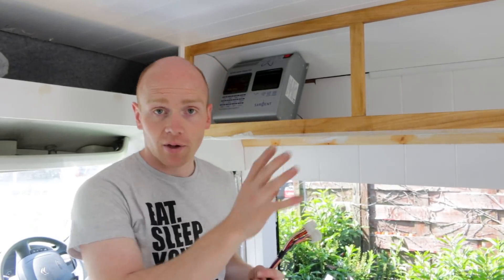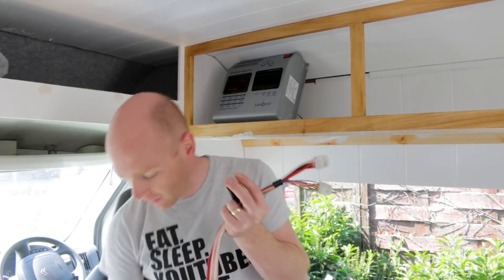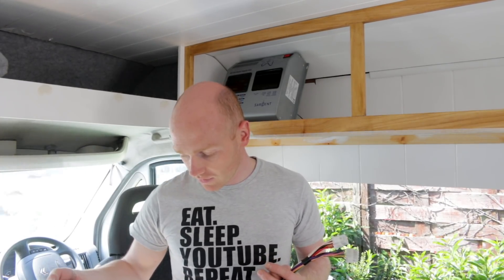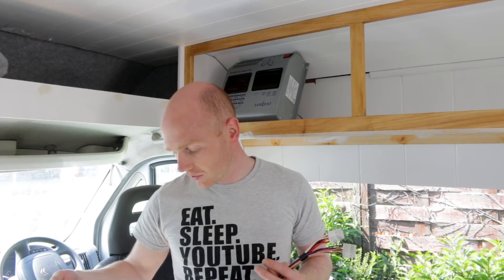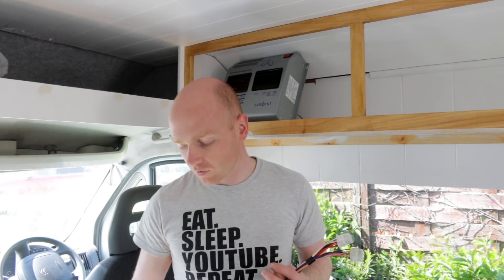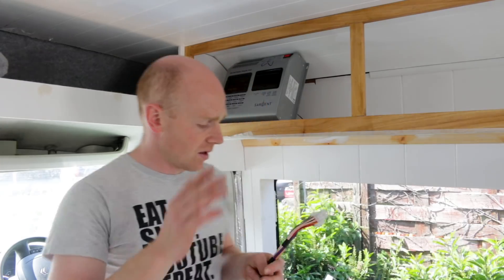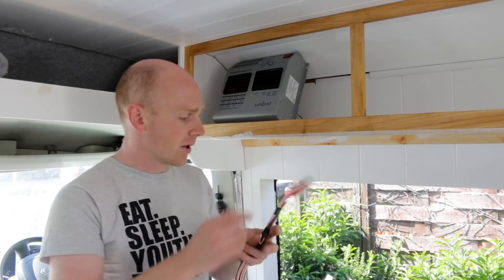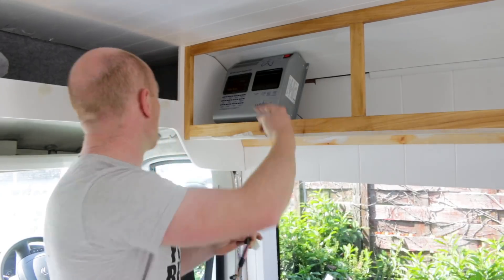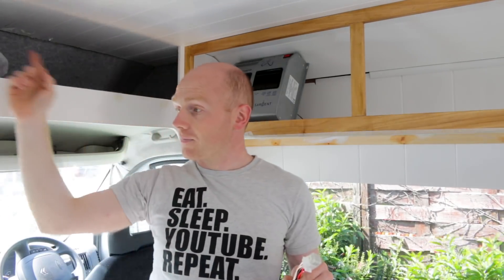They can just be bundled up and left redundant. The other part of the loom goes off to the leisure battery, the vehicle battery, there are a couple of earthing points there for the negatives, and there's a constant — if you had a three-way fridge, there are those wires. We are going to run a direct feed to our fridge anyway, so I'm going to split this loom up and run our supply section — the ones to the batteries — along the locker here and then run them down to our battery bay.